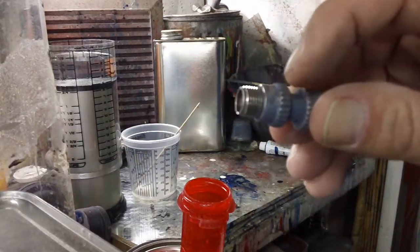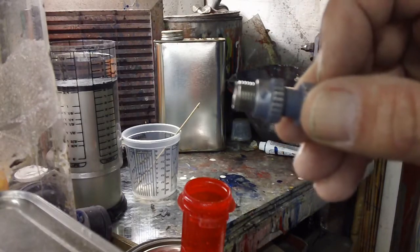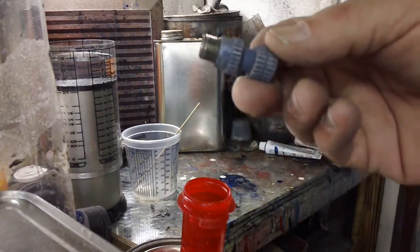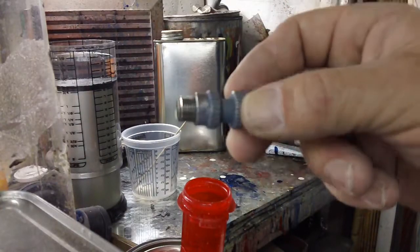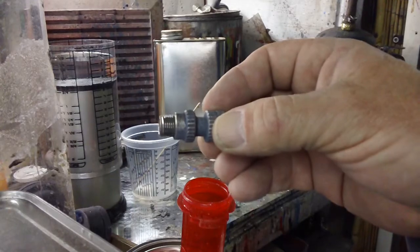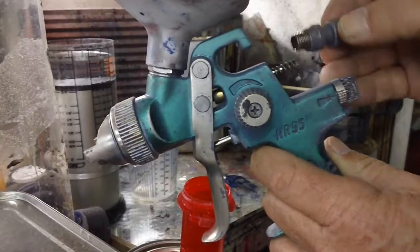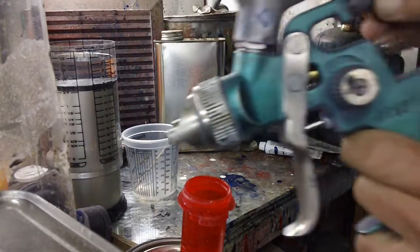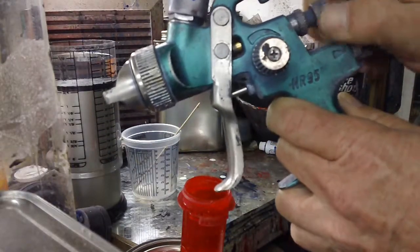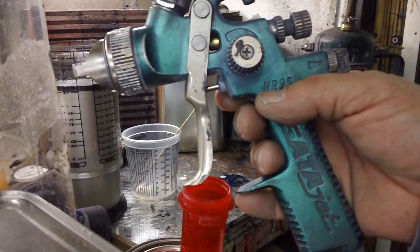And right here there's an adjustment lock that you move if you adjust your fluid. I never adjust the fluid on this gun. I adjusted the fluid last in 1995 when I had a painter helping me out. He'd come and paint panels for 50 bucks a panel. Anyways, he adjusted this gun last and I agreed with him, he had it. So it was set in 1995. It's now 2012. My point is that it never changes on this gun ever. And so I always know when I'm done cleaning it, just sock it right back up to its stop. And the fluid adjustment is set in stone.